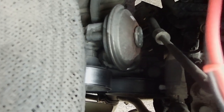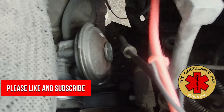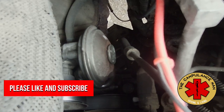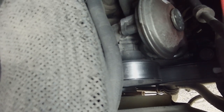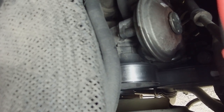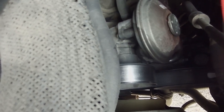Engine oil? I don't know. There's so little of it — there's not a puddle of it — that I can stick my finger in and smell to see what it is. On the backside, the body of the pump right behind the pulley, I can see metal fragments. So it's bearing material. This thing is due to be changed for sure.